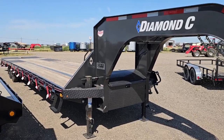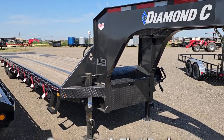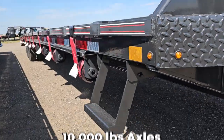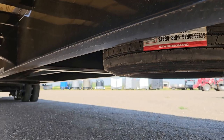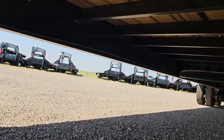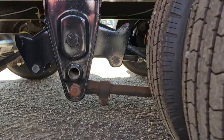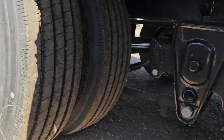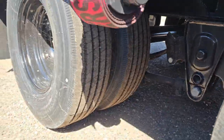For reference, both of these trailers are exactly the same — they're 40-foot long gooseneck flatbeds on 10,000 pound axles with a heavy-duty hutch suspension. The Diamond C has a slide track on one side with a torque tube going down the middle, and the PJ has the slide track with the twist guard. Heavy-duty style suspension on both trailers — apples to apples, same setup.